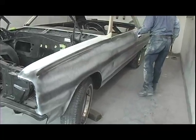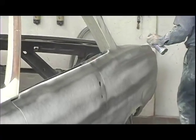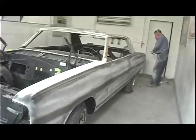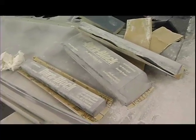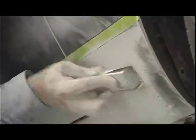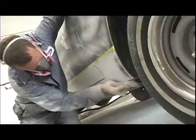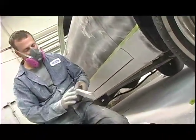After John guide coats the entire car, the actual sanding begins. John uses DuraBlock sanding blocks to back his 220 grit 3M sandpaper to keep the panel straight without introducing finger marks. DuraBlocks are rigid but they still allow the block to contour to the panel. Although sanding an entire car by hand is a lot of work, the Standox polyester sands off easily.